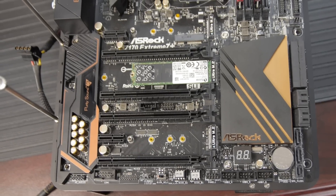We've got four full-length PCI Express Gen 3 slots. The first slot is an x16 slot that can operate in x16 or x8. If you're going to use two graphics cards, that's going to be an x8/x8 configuration, and that pulls directly from the PCI Express resources available on the CPU.